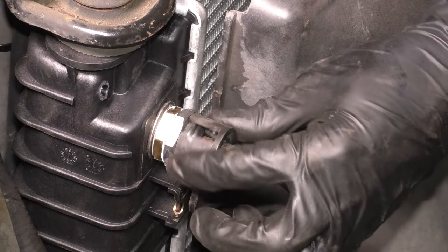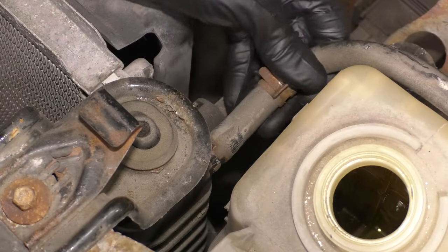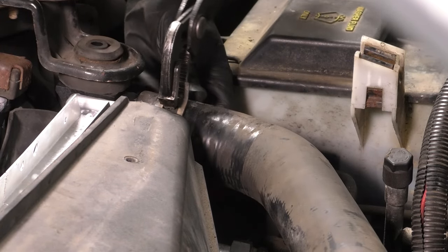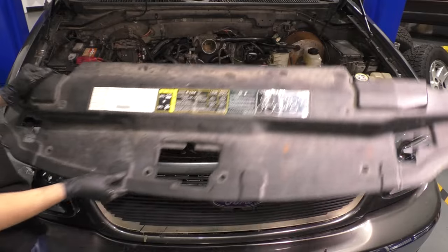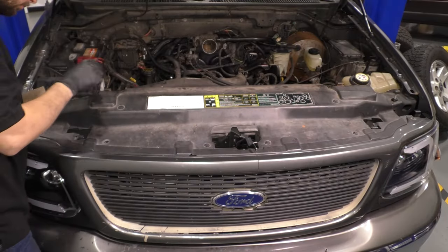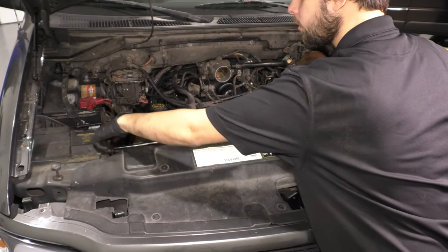And then we'll move on to the radiator, put the transmission cooler lines back on. You don't need a tool to put those on. You just press them in and then bolt the fan shroud down. Put any other hoses on the radiator that belong there, such as the upper radiator hose and the overflow. And then once you put those clamps on, we can put the plastic piece or the shroud that goes on top of the upper radiator support back on, clip it down,